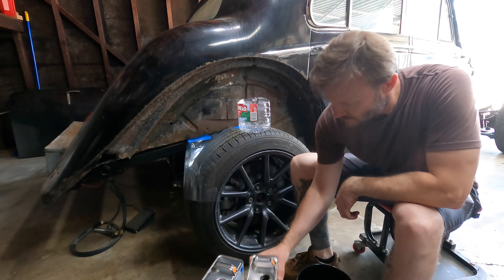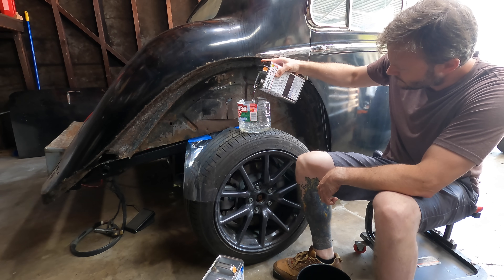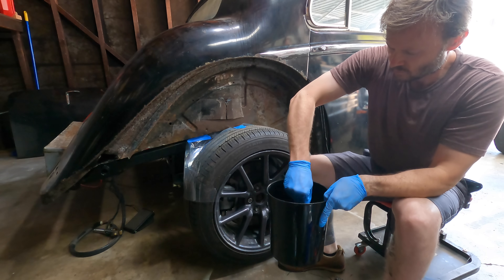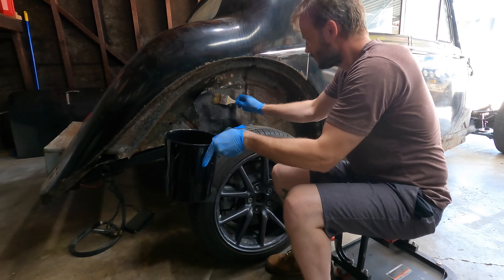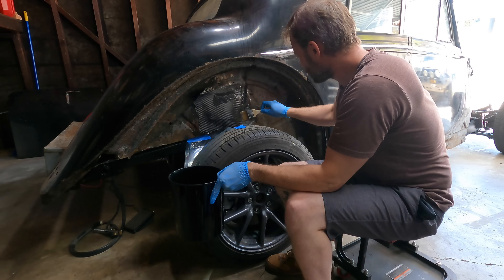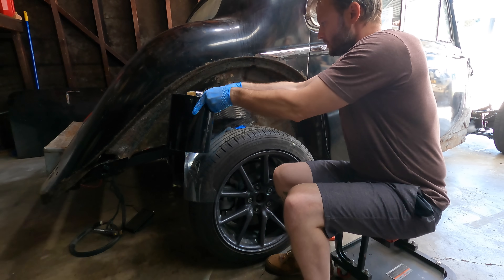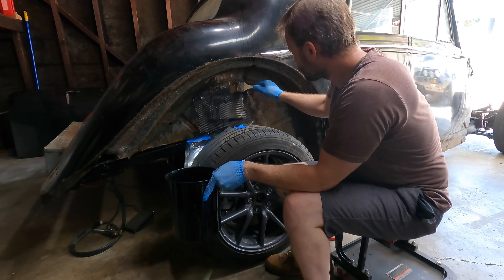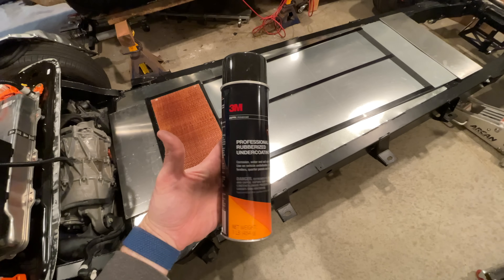I could have bought fiberglass from the local auto parts store, but I could just reach slightly to my left and pick up the carbon fiber sitting in my garage. I also don't have a measuring cup to correctly measure the three-to-one ratio of epoxy, so I just eyeballed it using an old water bottle, then mixed it in a trash can I had lying around, which I wiped mostly clean. I cut out some squares and painted them on, putting down plastic sheeting to keep drips off the floor and suspension. I cleaned the area with a wire brush, sprayed some Ospho to neutralize rust, then wiped it down with acetone. I put two layers on the outside and one on the inside, and did the same with the other side of the trunk.